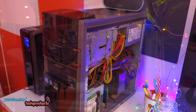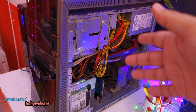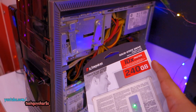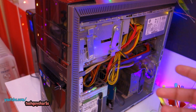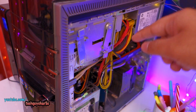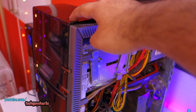I've finished the cloning process — it was a little complicated. I cloned the boot drive onto the SSD. You must make sure that the used space on your boot drive is less than the capacity of your SSD — so if you have a 240 gig SSD, used space must be under 240 gig; for a 128 gig SSD, under 128 gig. After cloning, I disconnected the SSD, used Windows installation files downloaded from Microsoft's website to format the old boot drive, then reconnected the SSD. Now we are going to boot.